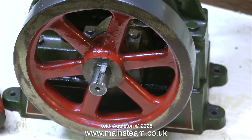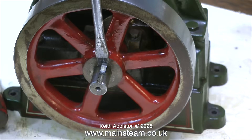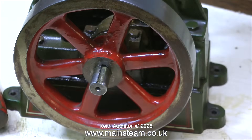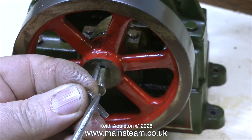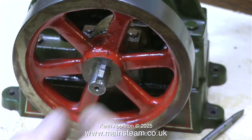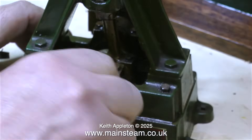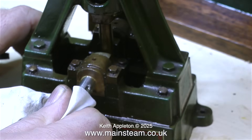The blade didn't shatter because I was very delicate with the hammer. Now I can first get a small screwdriver blade behind the key, followed by a larger one. By doing this and being very gentle, I don't mark the flywheel and I don't mark the key. Whenever you make the small metal key that holds these parts together, it's a good idea to put a slight angle on the key - that way you can get a screwdriver point straight in without having to use a Stanley knife blade. Now, being very grateful that the flywheel hasn't been Loctited to the crankshaft, I can remove it easily. The next thing is to give everything a wipe with a cloth to get rid of most of the old oil and grime.